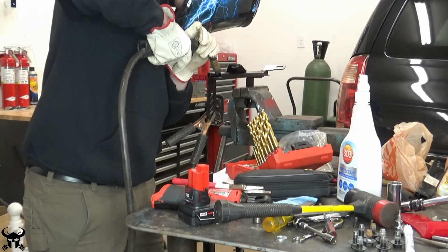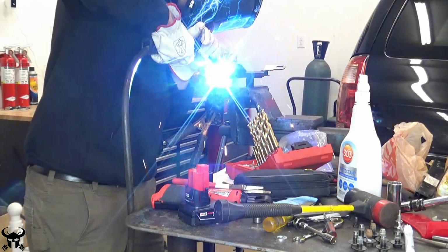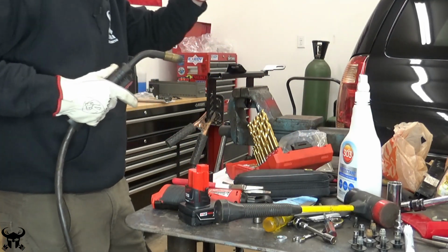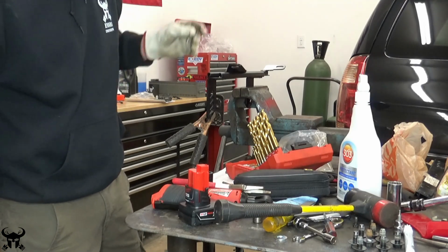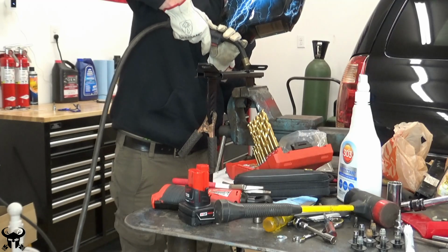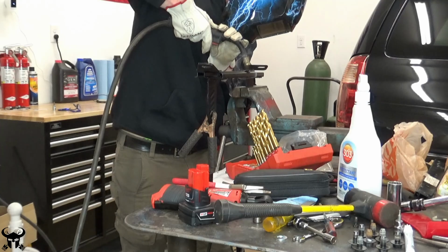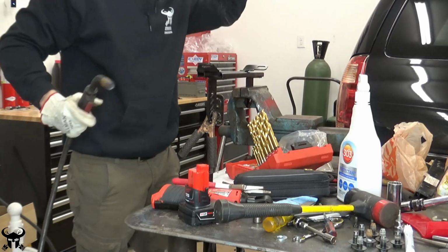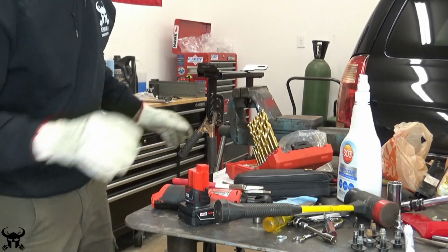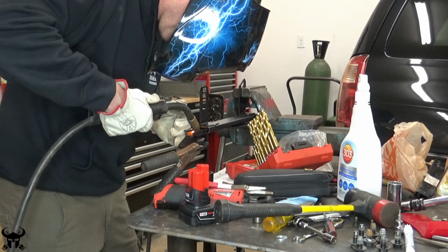And then also the seat rails, you can only mount to basically the top mounting position. Otherwise, these Recaro Pole Positions hit the floor. So the only position you can use is the top position, so they're not that adjustable. And also getting them installed in a way that they didn't bind on the floor of the car or bind on anything else was really difficult. You have to basically tighten it one bolt at a time, while making sure the sliders all still work. Maybe that's par for the course, but I did not have a lot of success with these Nagisa seat rails.